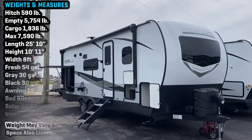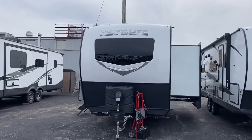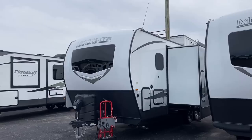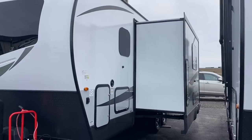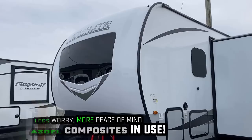With the weight and size of this one, I think it very nicely qualifies for what we would generally refer to as half-ton towable. You sometimes got to watch yourself on some of these Murphy bed models — they do have a little more bulky construction up front, especially with the way they accomplish this one. What that means is the hitch weight can be a little bit higher, and that might be an issue for some tow vehicles. So you're always going to want to check not just your tow capacity, but also your payload capacity to make sure you can handle the hitch weight.